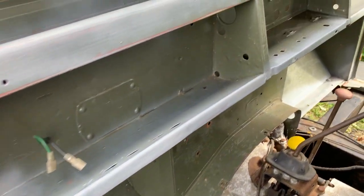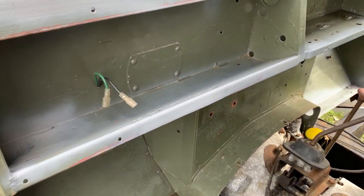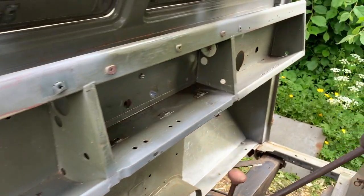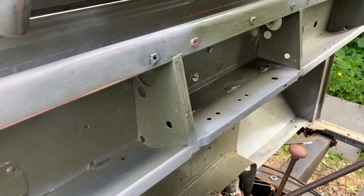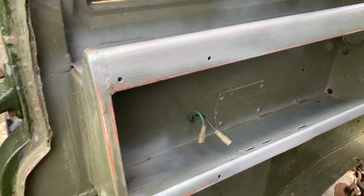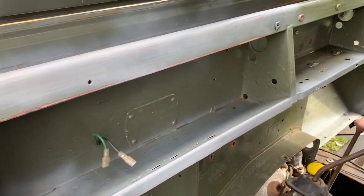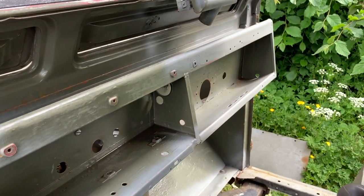So after rubbing it down, I don't need to rub it down to bare metal, this has been done before, you can see that this bulkhead's in really good condition anyway. I've given it a quick rub down with a 120 grit, just to give it a key, and then a slightly finer, I went to about a 600 I think,